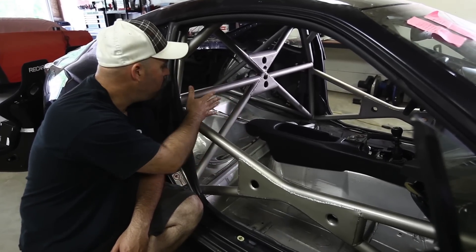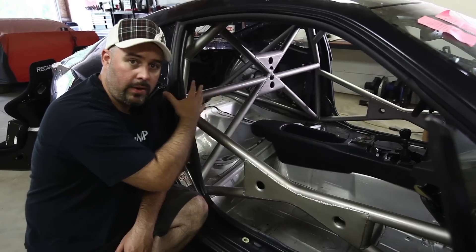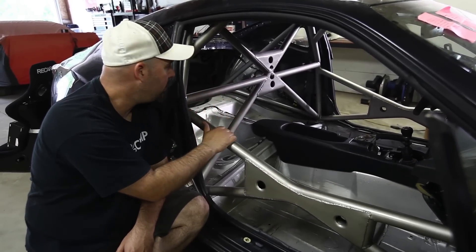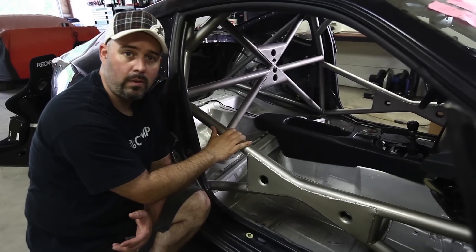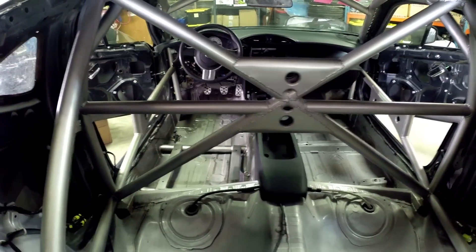The main hoop has been moved back close to a foot, which gives us a lot more clearance as driver and co-driver from the cage structure itself, so it's better for safety. It also fits much tighter up around the roof structure, so it's just a better fitting cage. It's also lighter — we think we took about 50 pounds of weight out of the car just by using a simpler cage design.